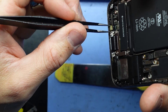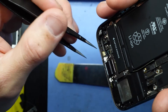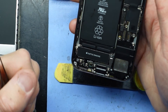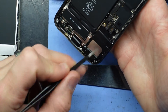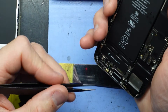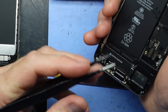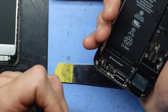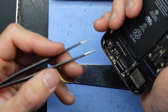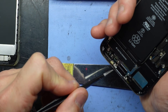So that should be just a quick swap. That is one method to potentially save a whole bunch of drama — I've found that a lot of charging ports I've come across lately have either faulty microphones or the charging port is still broken on the new one, which is just crap. If we can leave the quality charging circuit in there and only replace the faulty microphone, that saves a lot of time and hassle. This method involves only six solder points and a circle — most people in the phone repair industry who have used a hot air station should be able to do it. If you can replace a USB jack with a hot air station, you should be able to replace this microphone.